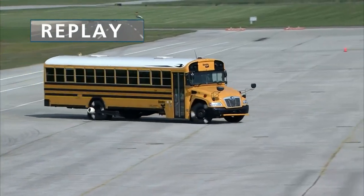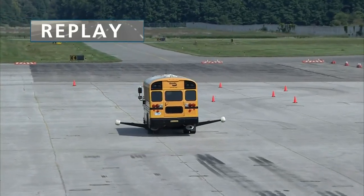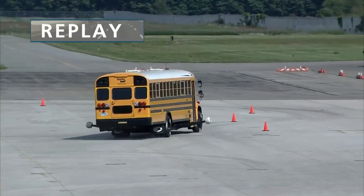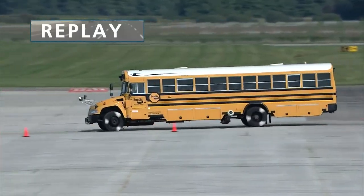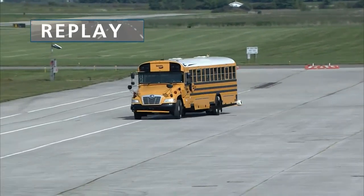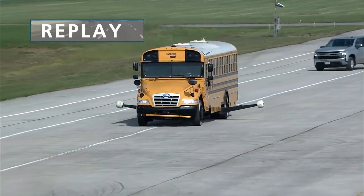All right, I'll try not to be. So here we are coming around — this should be with the system on. As we talked about before, this is the beauty of stability control, because a lot of times the driver may not feel the rollover or loss of control coming. So what stability is doing is anticipating that we're going to get into this situation, and it's going to help the driver out by applying the brakes as necessary. It doesn't always apply the brakes, because sometimes all you need is a little trim — it might just cut throttle for you to keep the bus from losing control. But when you hit that hard braking like we were hitting out there, that's when you know you almost lost it.